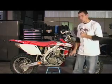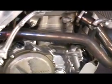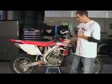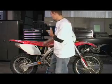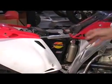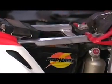And in conjunction with that, we put a new exhaust system on it to free it up a little bit. This is a Dr. D Dubach Racing full system SA exhaust. We did a product review on that — you can read more about it if you like. Excellent piece as well. And on the other end of it, it's opened up and flowing out, so we had to open it up coming in. What we did was chop the air box out. There are some easy air box mods you can do that basically turn it into a 450R air box — cut out the top. As you can see, I can put my hand down in there, which made it a lot more accessible for more air volume to start flowing through the machine.